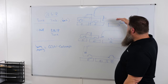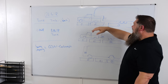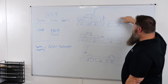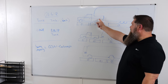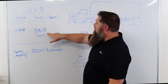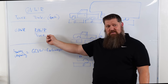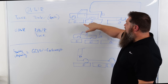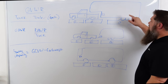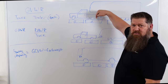This is just how physics works: if I have more weight on the trailer side pushing forward in front of the axles, more weight will be pushing down. There may be a situation where I have enough gross vehicle weight rating on the trailer but too much weight up front. In that case, I'll need to move some cargo behind the axles to lift some of that pin weight off the truck. Take the first rear axle number, subtract the second rear axle number, and make sure you're not over the rear axle weight rating.